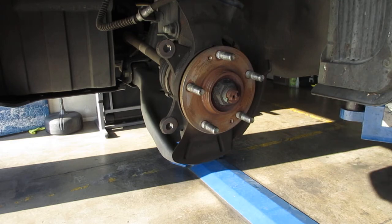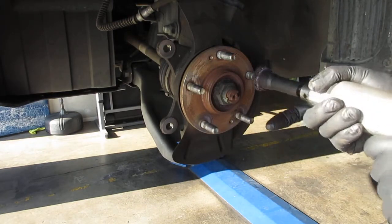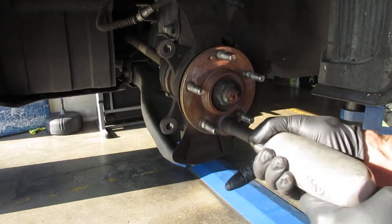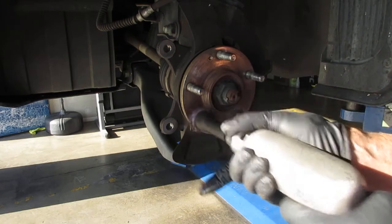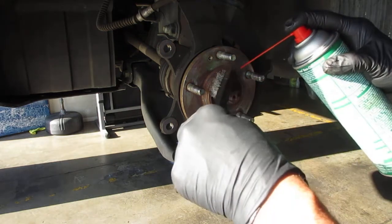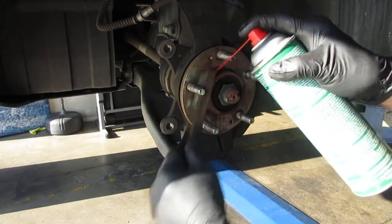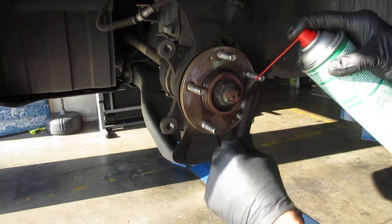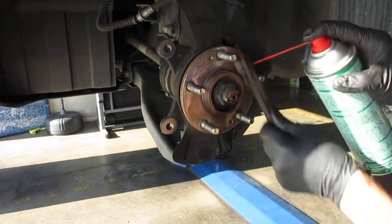I have a little tool that goes right across the front of the stud and cleans that off. You'll get to see it. Then we'll clean in the middle. Then the very inside little bit that you see along this edge right here, I take a little bit of brake cleaner and spray it in there, and take a little wire brush here and get that last little bit out of there. So you're still going to have a little spot, you know, here or there. It's not all going to come off, but a great amount of it did.